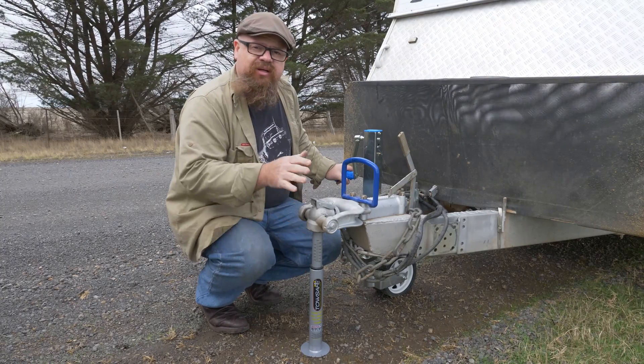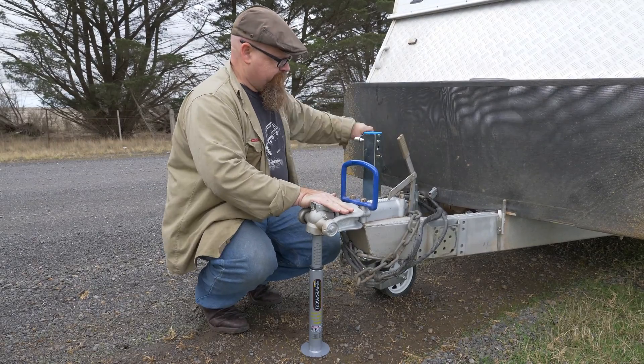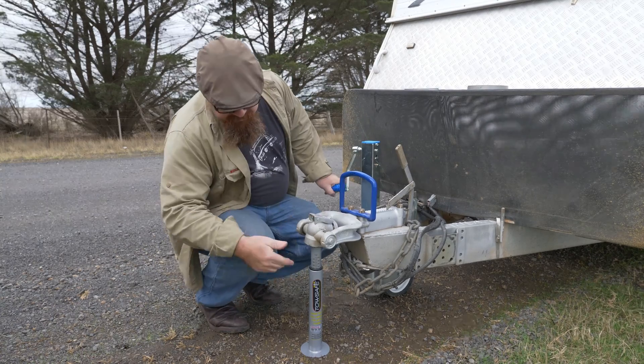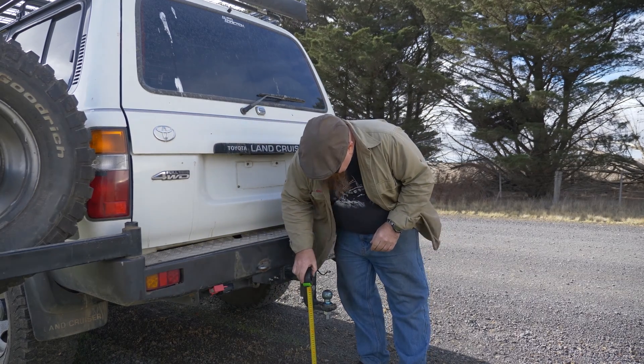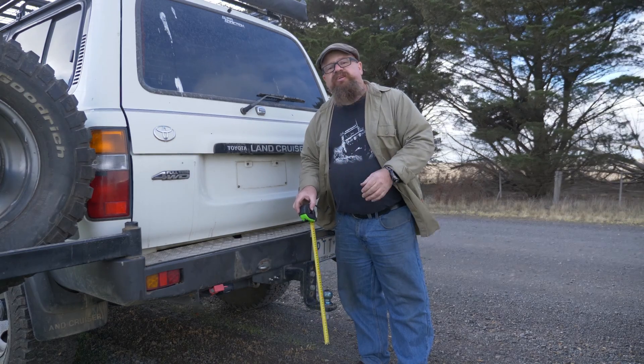We're out in the bush here. We've attached the caravan and the back end is dragging — we don't have any pressure in the bags, and that's because of the tow ball weight. We've got a tow ball scale here and we're going to lower the tow ball of the camper onto the scale and check the weight — that's around about 200 kilograms. So with no air pressure in the airbags and no tow ball down pressure, we're sitting at about 410 mil. Now let's put some pressure in the airbags and see if that changes the height.